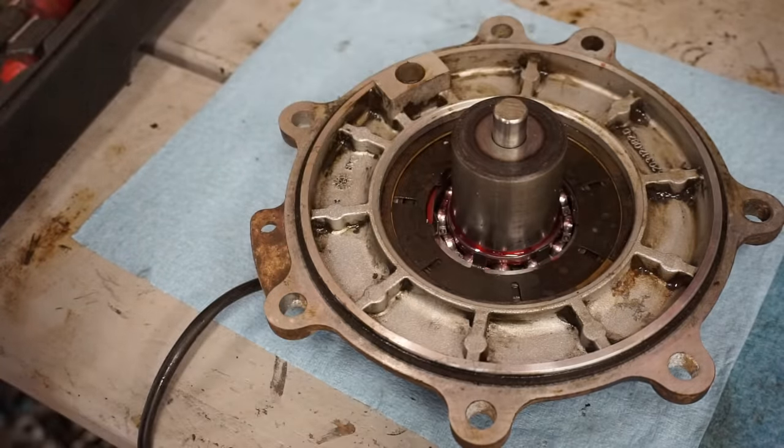All right, now the bolts are loose. Now we're gonna torque them back to 11 foot-pounds. Now you can see I marked the bolts with a permanent marker. We're going to turn them a quarter turn and then another quarter turn, and that will be good to go.